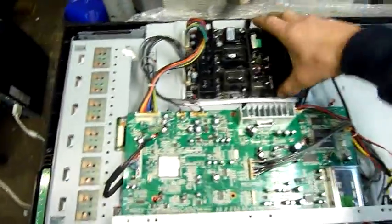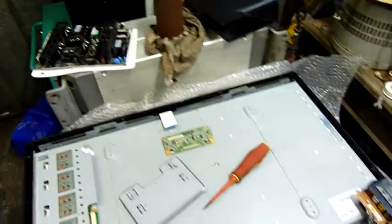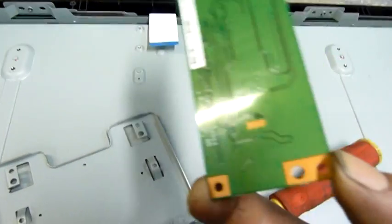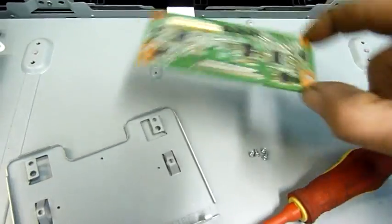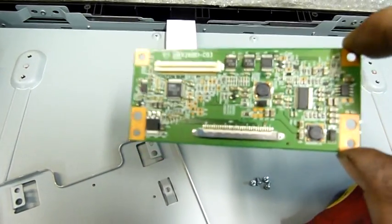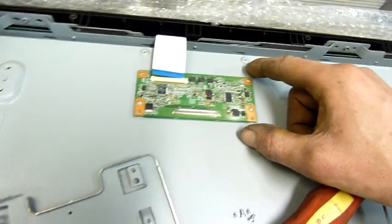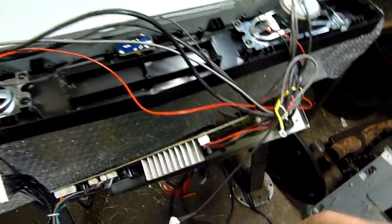Okay, now we've got a pile of bits. This is the little board that the video input cable goes to on the back of the panel. I don't believe this is the problem but I just thought I'd reseat these ribbons just to be sure. Everything looks pretty good — about as good as you get with lead-free solder anyway. I don't have the equipment or patience to re-solder any of that tiny stuff, so it's going back on as is. The panel seems to work fine with the on-screen display, so I'm guessing the problem's in there.